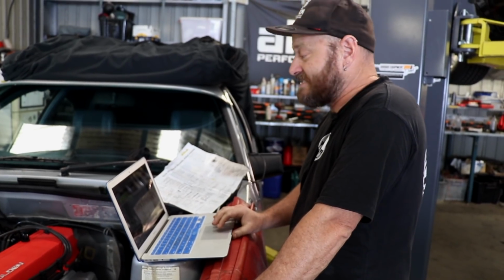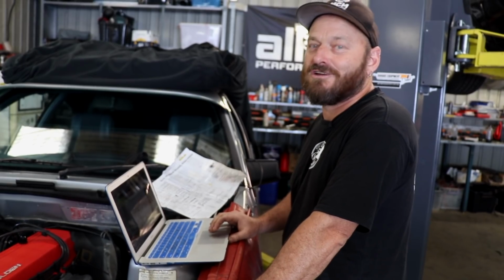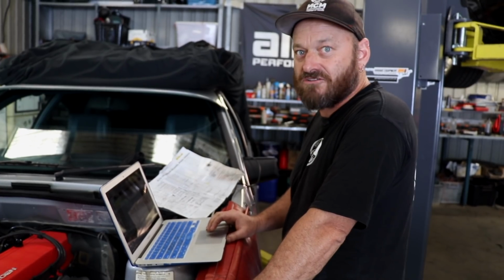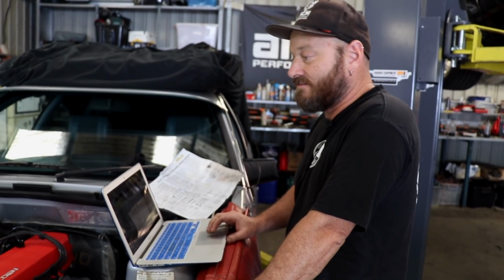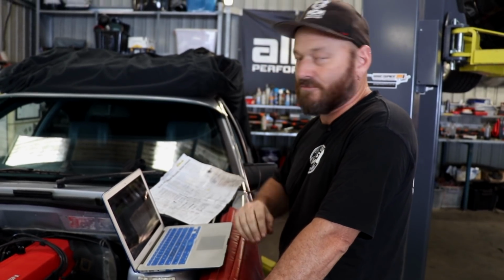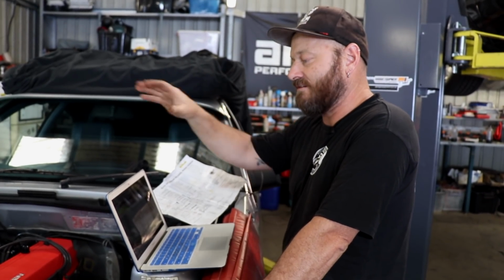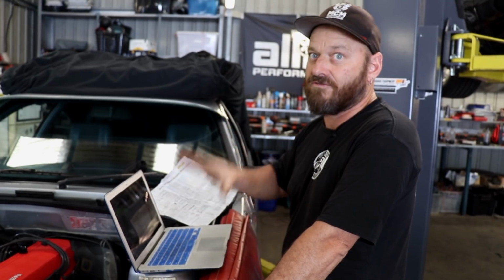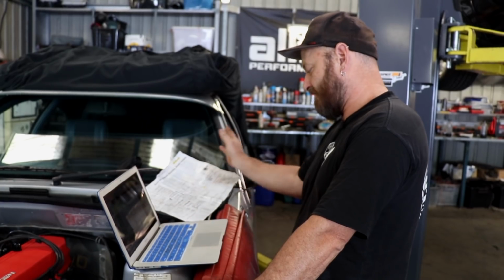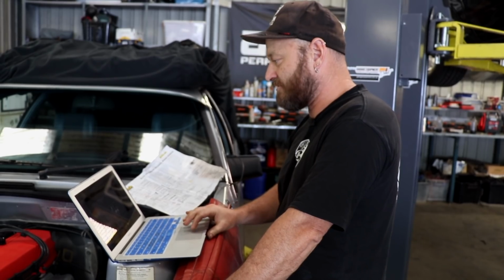So when you first plug your ECU in and turn it on, it is very important that you do not crank the engine over. There's so many variables of trigger types and all that sort of thing, engine configs. If you crank the engine, it will probably either fill the engine up with fuel or do all sorts of stupid things. It's got to be all configured first. Don't touch anything. So we open it up. It's going to have errors everywhere because it's not configured, because it's just got a base configuration in it, so you can switch it on.